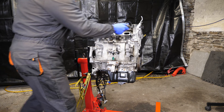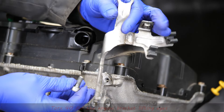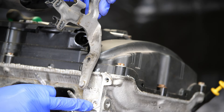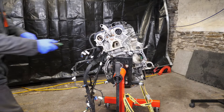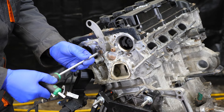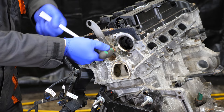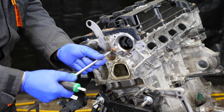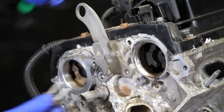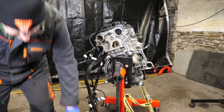We can go on to the lifting eyes - for that it's a Torx 40. That's one side off. There's a little lug, a locating dowel, just noting that. And then we've got another couple on the other side for this lifting eye. I try and use long tools so that the camera can get a better view of what's going on. Both of those screws are the same length. There's a bit of sealant there that was sticking that on.